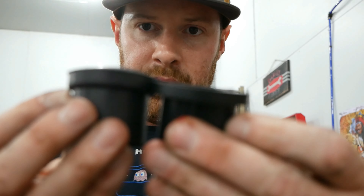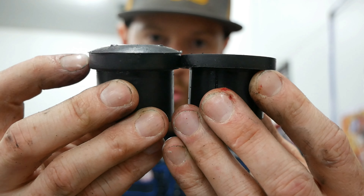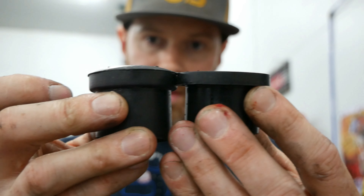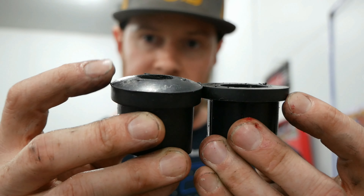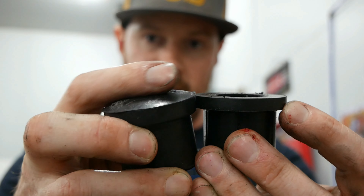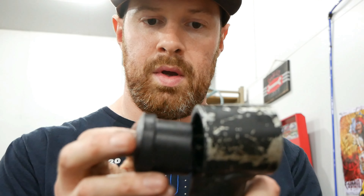If you look at the bushing halves here — the rubber bushing actually has a thicker bushing hat and it's actually domed a little bit. So in order to get that to be the same dimension as the old one, I'm going to have to take this to the sander and sand some of this off and make the overall height of that bushing half a little bit shorter. That'll just make sure that when the bushings are pushed back into the sleeve, they'll fit in between the tabs that I have welded on the cross member.